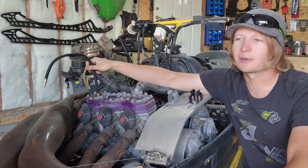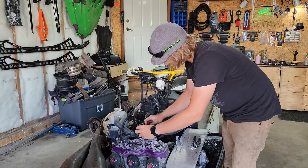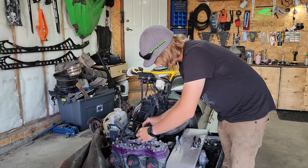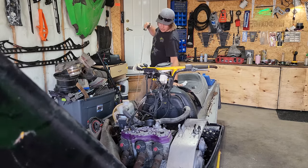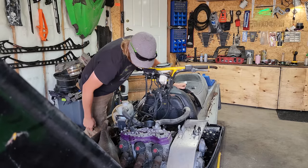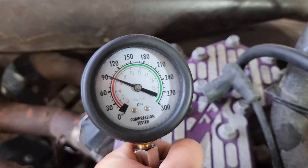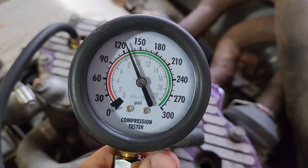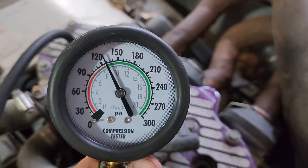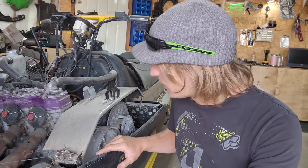Since this is the one I'm actually worried about, I'm going to sit here and watch the numbers climb. On the piston I thought was going to be an issue, we're actually sitting at that 128-129 mark. I decided to double-check the PTO piston just to make sure, and it came up to that 128-129 mark too, just like the others. We're not going to open up that motor — we're definitely going to leave that motor alone. I'm pretty well happy saying the motor is fine.